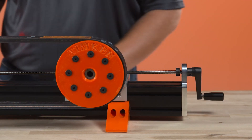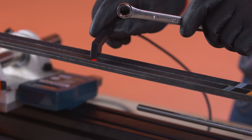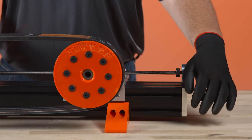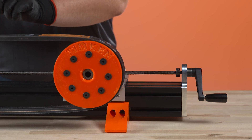If the reading is below the desired range, then tighten the belt. If the reading is above the range, the belt is too tight. Adjust as necessary and recheck the frequency until it's in the proper range.